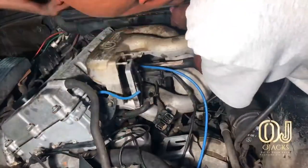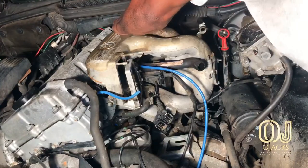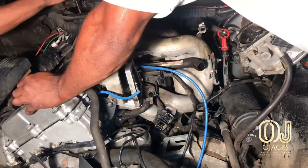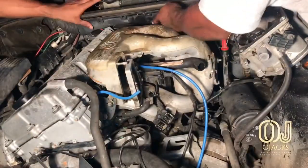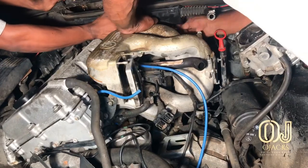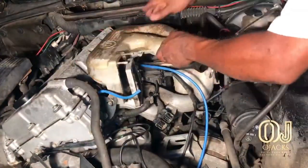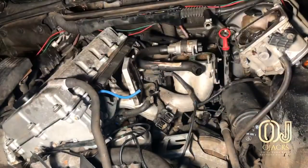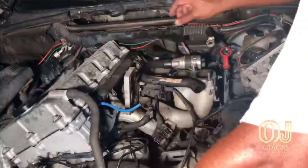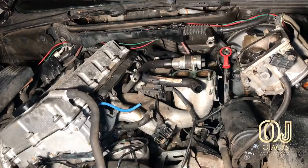On top of that, I took off the, I'm still trying to take that upper intake off. It's connected on the side over there. It's a bolt over there, and some kind of bracket to keep it in line. When you're disconnecting the starter, there's a bracket underneath that intake. Well, not that intake, but up under the other intake, with two bolts, and you can move it back out of the way, and then you get to the bolts on the starter. That's part of the intake, a little block that the water line is running through.